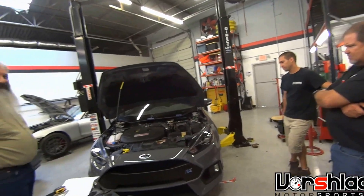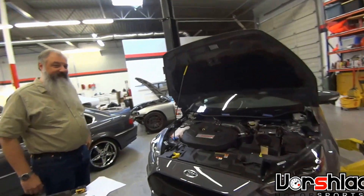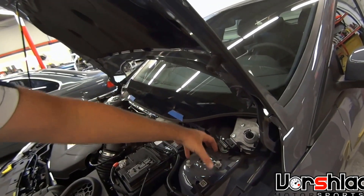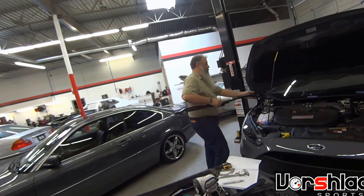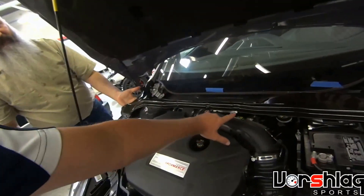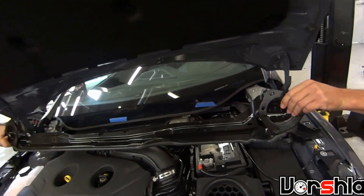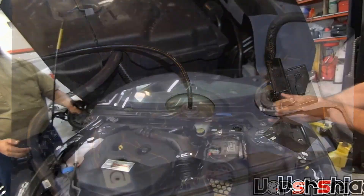We're standing around with the whole crew here — this is what it takes, four or five guys, to tear a car apart to do camber plate design. This is the new Ford Focus RS. A lot of challenges here. Underneath, we've already shown a video showing how big the spring is inside the strut tower — not a lot of travel. What we're trying to do is move the top of the strut inboard to gain negative camber. The challenge is all the stuff on top of the strut towers that's in the way. There's this big strut tower brace — seven and a half pound brace — it attaches here with three bolts, and on both sides the two wiper motors go through. You can see some weld nuts underneath and there's some Tupperware that mounts on top. The wiring for the adjustable shocks goes through here. Getting this off took 20 minutes of puzzling.